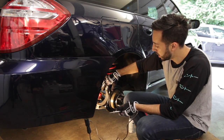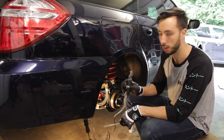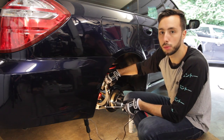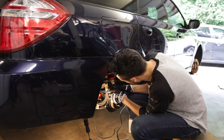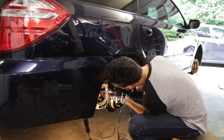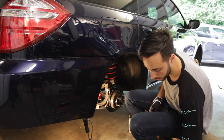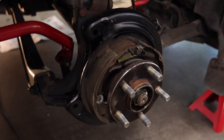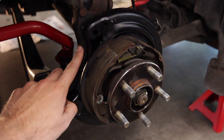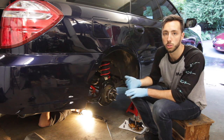We've clearanced off most of the metal needed for that bolt head to fit using the grinder. To clean up and smooth that out, we have a hand file and a Dremel with a wheel on it, and then we'll take some sandpaper and paint it so it doesn't have any issues with corrosion or rust down the road. The Dremel got everything done — we have a nice smooth surface. Went ahead and sanded it down and painted it all black to prevent corrosion — it looks stock from the factory.